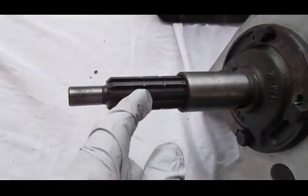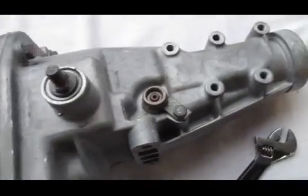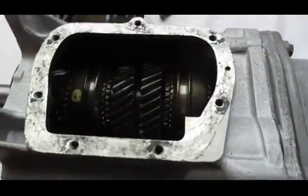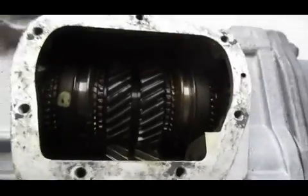You can see it's an M20 by the two grooves in the input shaft here, and everything on this transmission is just beautiful. You'll see more in the pictures, but the casting number on the transmission is 3885010. This case was used in the 66 and 67 model years.